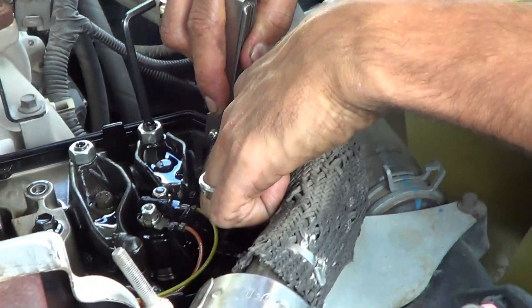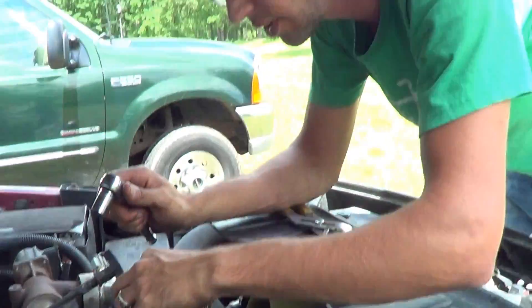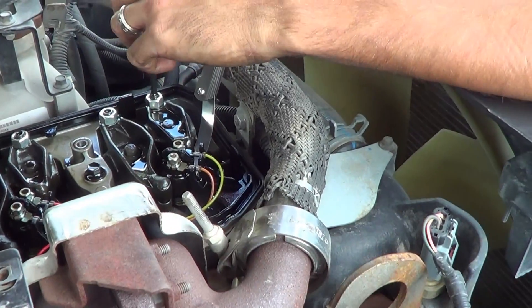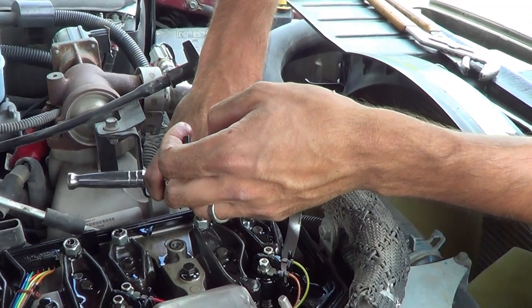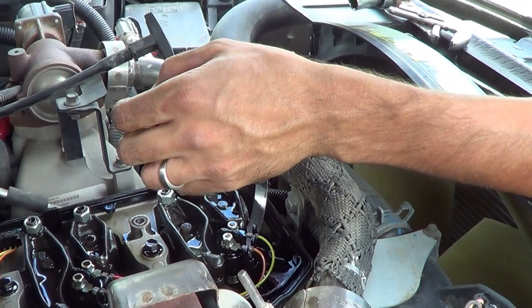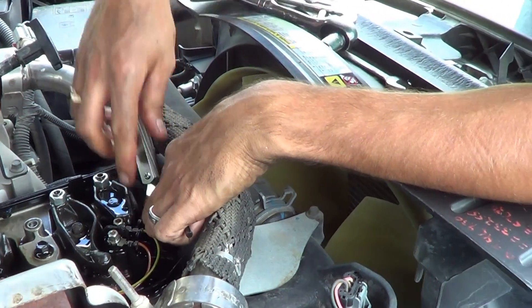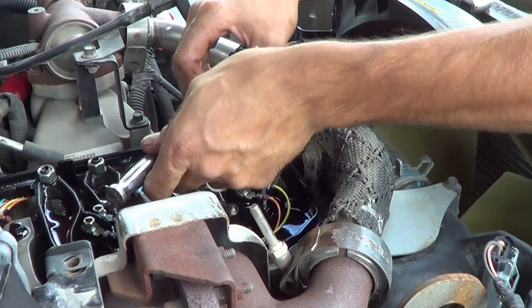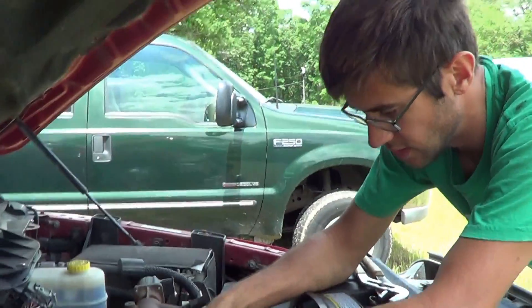I still feel the tension. Since I don't have a box wrench — which you really need to hold the adjuster in position while you tighten the lock nut — I'm going to see if we can do it without. Yep, we still have a little bit of drag and that feels pretty good. We're just going to tighten this one back down. Cylinder one intake is done.